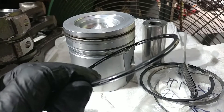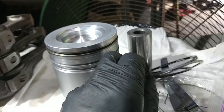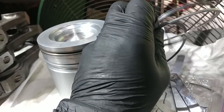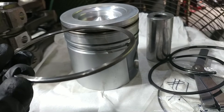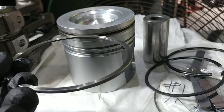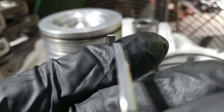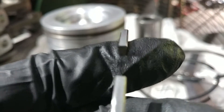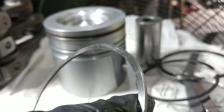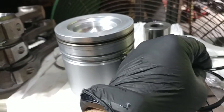We've got our rings here. If you look, you will probably not find side clearances for your main compression ring — because your main compression ring is a keystone ring. You can see it's shaped like a keystone, so it tapers down and obviously isn't going to give us a consistent reading. So those you don't have to worry about. Let's set that one aside and grab our intermediate ring.